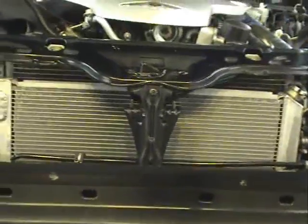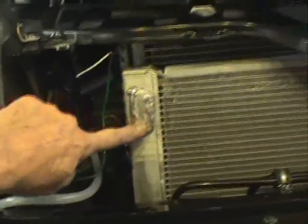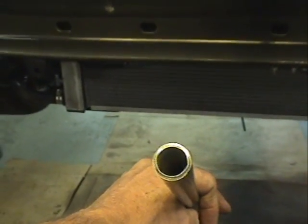So it's been a lot of fun — pretty simple installation. We've got a little petcock down here to drain, because you always want to have a way of getting rid of it. And that's it. About $175 for the heat exchanger, $25 for hose and a couple of little fittings — things like hose clamps, that kind of thing. The big deal was just welding the radiator up and cutting an inlet down here, which is just a piece of pipe, and another piece over here. I made it from a piece of old pipe from an RV store — I think it's like 800-thousandths diameter heavy wall tubing, something that's going to hold up. The rest of this we'll get posted Monday or Tuesday. Have a good one.